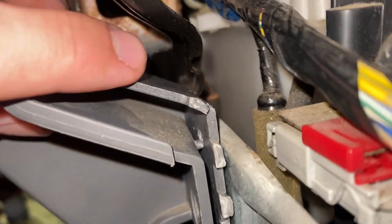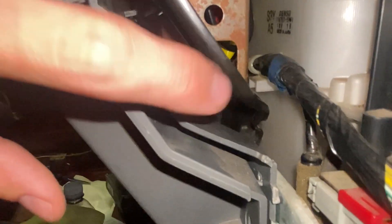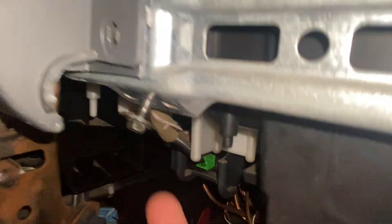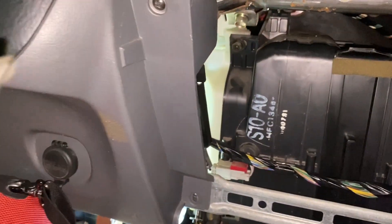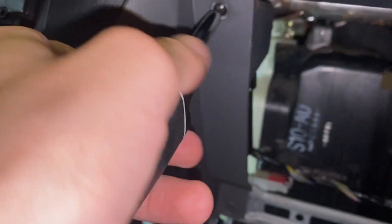So from there on this side, I believe this is the outer trim. This little plug right there goes into this plastic. If you can see, if I pop it back up, it goes back in, drops down, and then this secondary piece of plastic feeds into the metal bar right there. Once I loosen the 10 mil on the bottom, I'll give you a better angle. Another thing I suggest is always when you remove a screw, re-thread it back in so that you don't mix up where they're supposed to be. I'd recommend removing this Phillips head screw first, because this allows you to pop this plastic piece out, which will give you more access to that 10 mil.